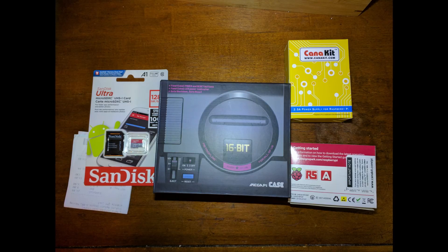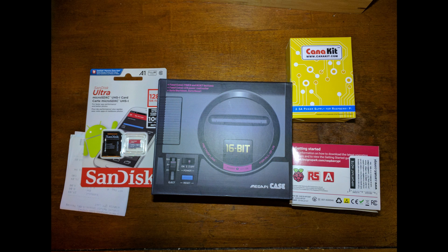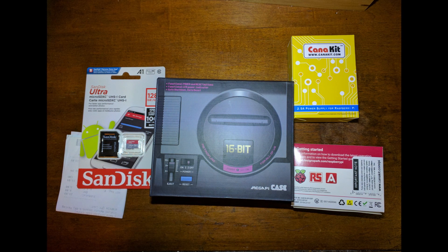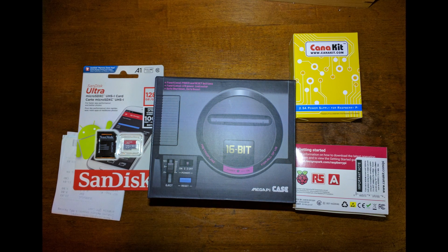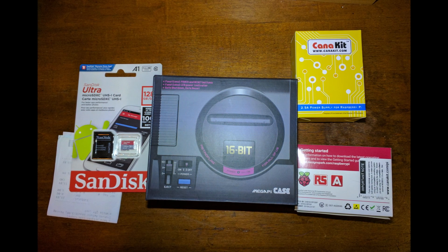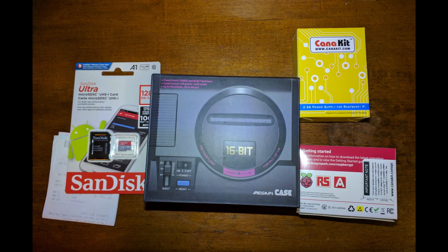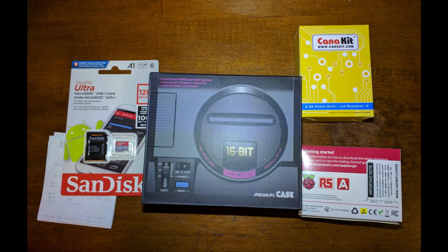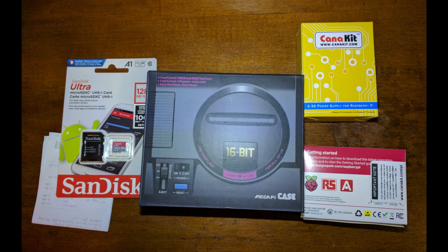This thing is really cool. I think you could build this whole setup for under $100. Everything you need is basically the Raspberry Pi itself, a power supply — most kits come with one, but make sure yours does. It needs to be at least 2.5 amp, micro USB 5 volt 2.5 amp. Then the case — you don't even really need this one, there are a lot of cheaper cases — and a microSD card. So yeah, even with this case, I think it comes in under $100.